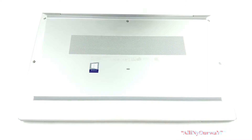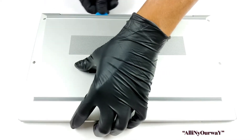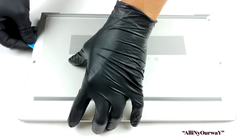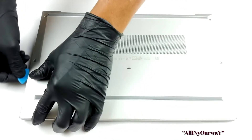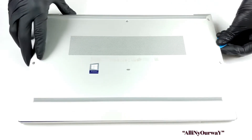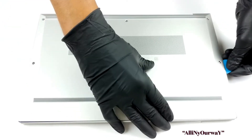Today we will show you how to open the HP EliteBook 850 G7 and what's inside of it. This is one of the easiest notebooks to get inside — you just need to undo five Phillips head screws and pry the bottom panel with a plastic tool, starting from the back.